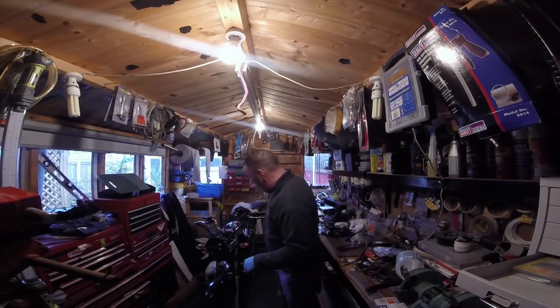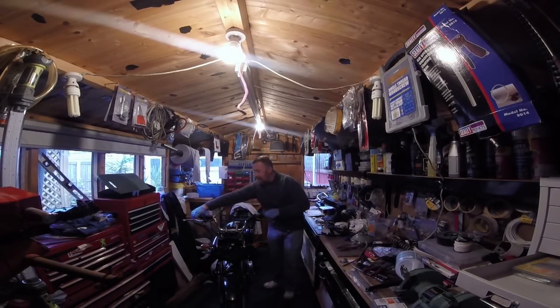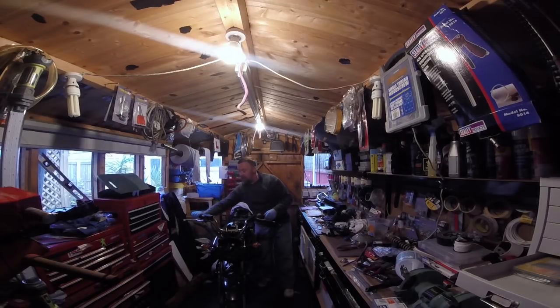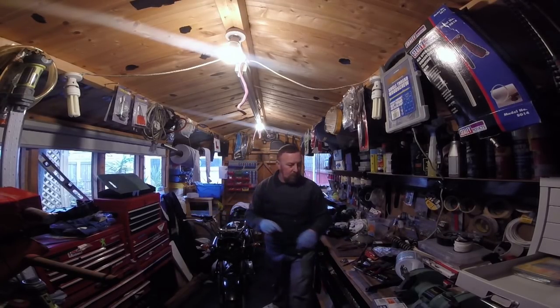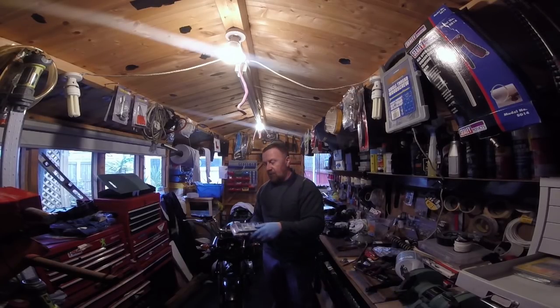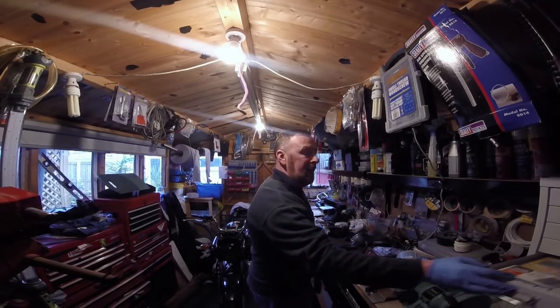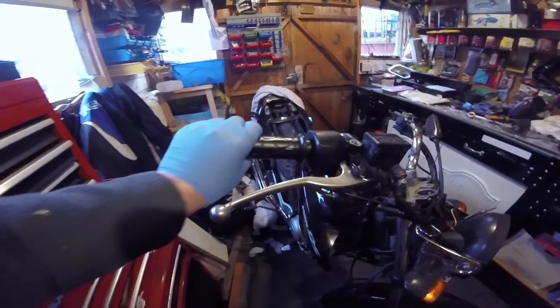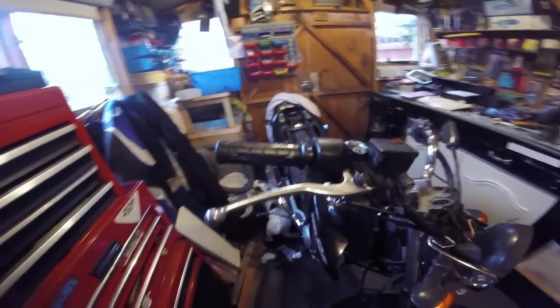You may notice the tank is back down and the throttle cable now works perfectly. It was damaged - what I did is drilled above and underneath where the nipple is on the cable, then bent one of them around it and clamped it. Now it's nice and tight. Let me show you that working.